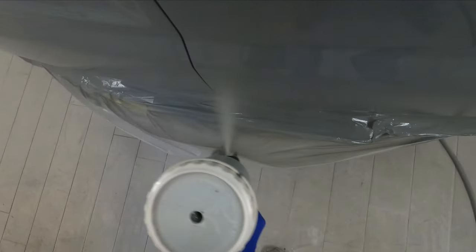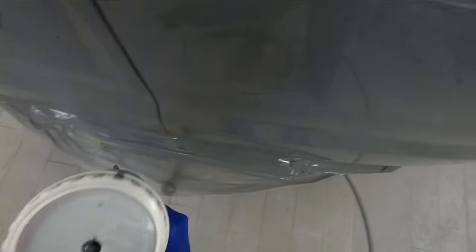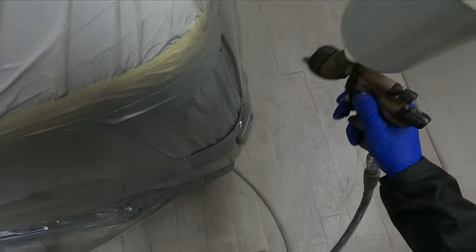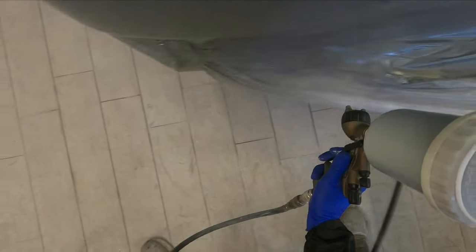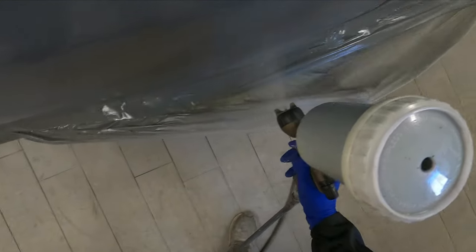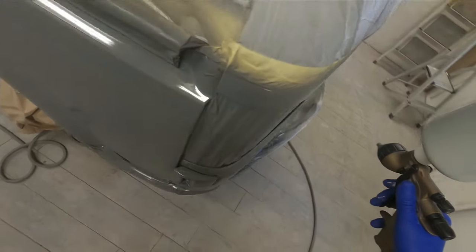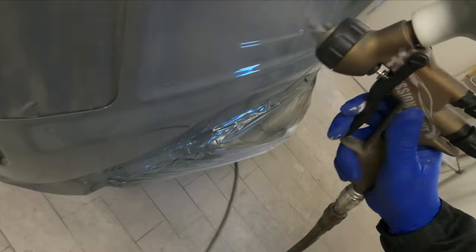Because if you put it outside and it gets damp, or if you've put some primer down and then taken it out and washed it off — even wet flattening primer can do this — primer is porous. So even though you think you've dried the car off, and yes it will look dry and it will feel dry, the primer and filler and a lot of the products that we use before we put the top coat on are porous. So you want to make sure that if you have the option like we do, you put it into the booth, give it a quick bake, and that will stop any further problems down the line — because that moisture will start to seep out and will start to make the paint pop and can cause all sorts of issues.